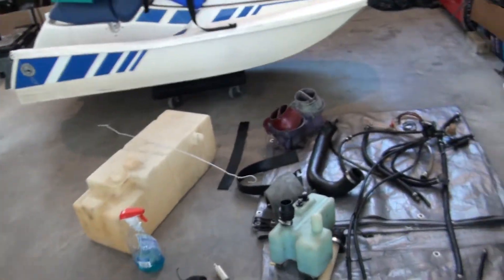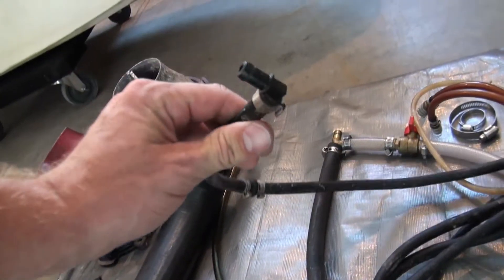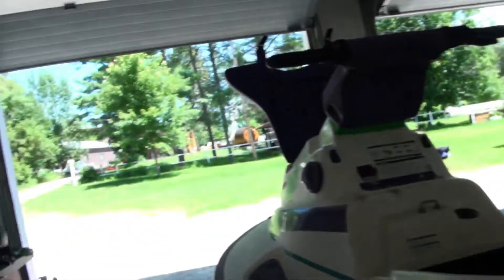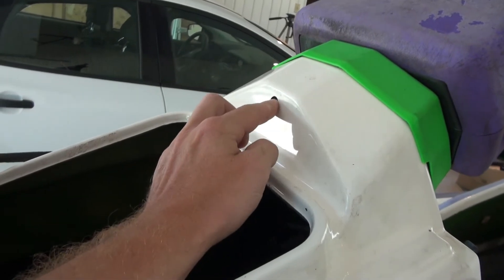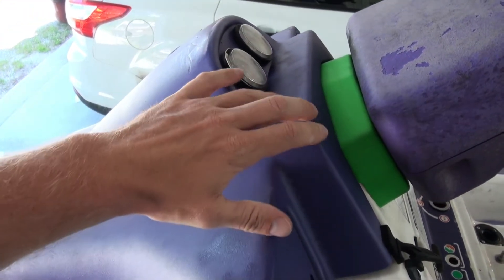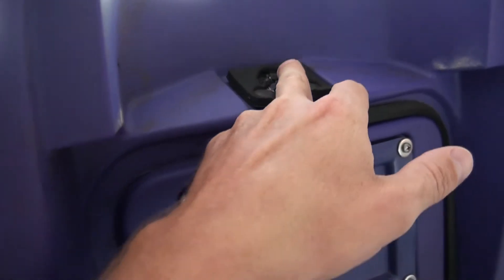There's a little air breather here that hooks into the fuel system. This little tube here hooks into that grommet, which goes into the fuel tank so that the fuel tank can breathe and doesn't get locked up. There are actually two points where that happens — there's that little grommet in here, and there's another tube that comes up here with another rubber grommet where the fuel tank can breathe. When the hood goes down, that grommet kind of meshes up with this little hole here.